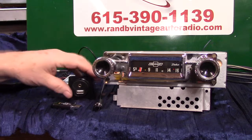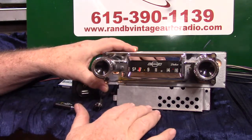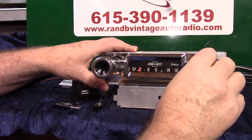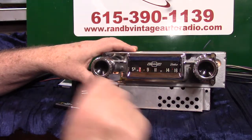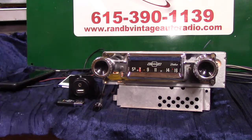There it is — it switched back over automatically. That's what we want it to do. Now this radio will scan your stations for you without the needle moving. All you do is take your tuning knob and go up twice — one, two — and a little light starts flashing, and it begins scanning stations.